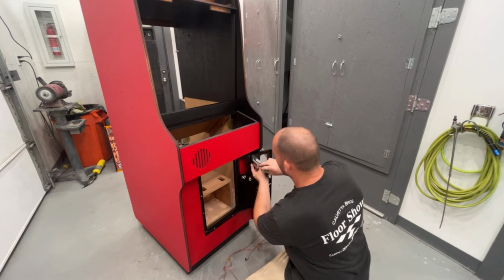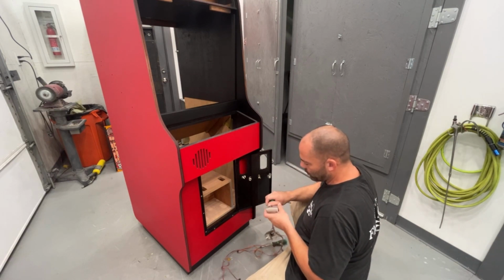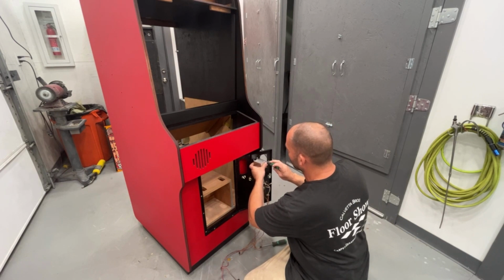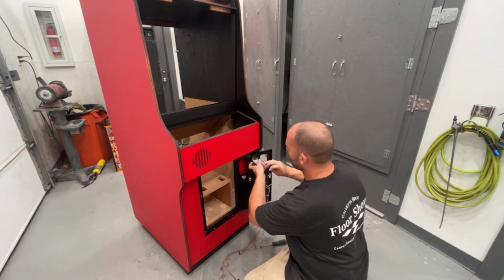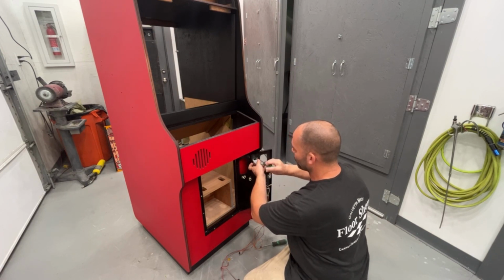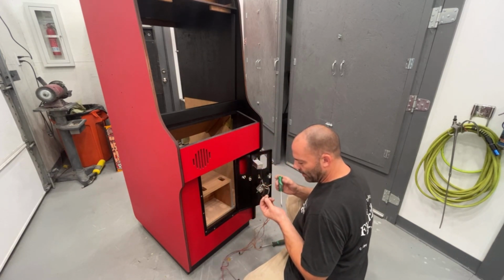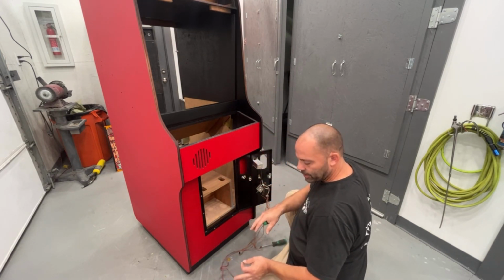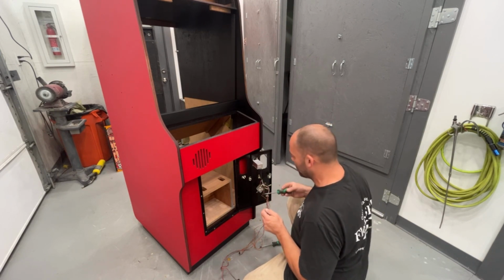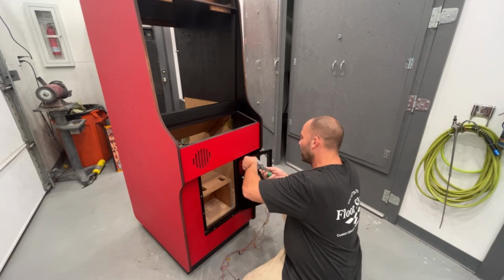Now I found out while using that tumbler with the Desert Blend crushed walnut shells, you're almost better off throwing them away after one or two uses rather than keep using them. Because when you keep using them, they turn into a fine powder and then they end up getting stuck in all your screw heads. I didn't realize that at first when I kept reusing the media. But on these parts, I used part of a brand new bag, and there's no media stuck inside the screws because the pieces were bigger at that point.